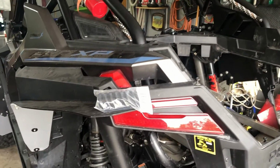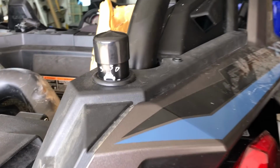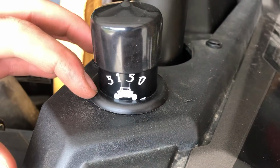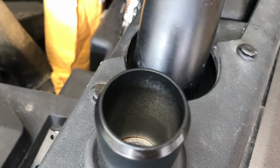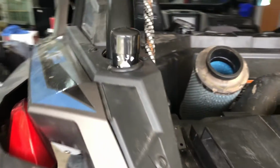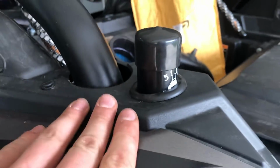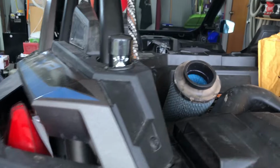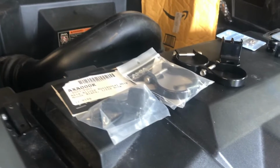So I'll go ahead and get those put on there. So we got the 5150 mounts put on. We just had to drill a 1 3/4 hole, and then that grommet that I was telling you guys about fits in perfectly, and then the mount fits in real nice. Kind of finishes off the deal. They're super snug. Plastic doesn't really move around anymore, which it did before, which kind of frustrated me. You could pretty much come here and shake this whole thing. Now it's pretty solid.